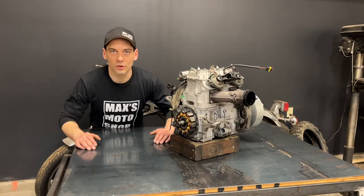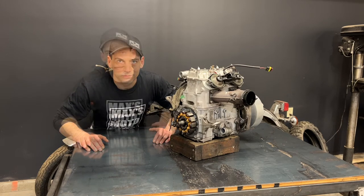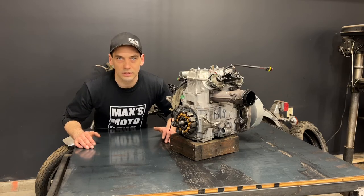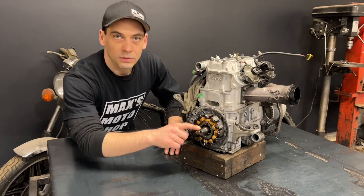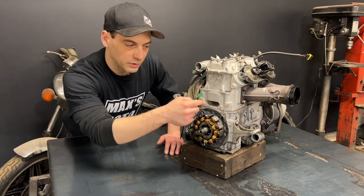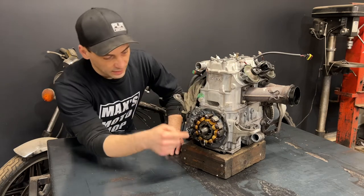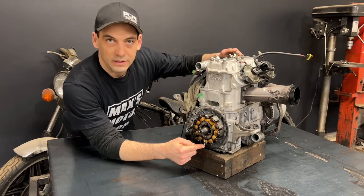The first thing you need to know about these crankshafts is they are two pieces forged separately and pressed together in the middle. Out of phase means that joint in the middle has slipped and the motor is out of time. Now on this 800R motor, the flywheel key will be pointing straight up to the 12 o'clock position when the mag side is at top dead center, and straight down to the 6 o'clock position when the PTO side is at top dead center.